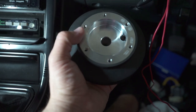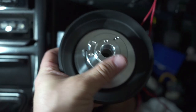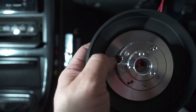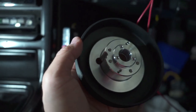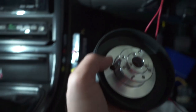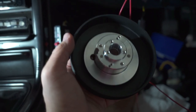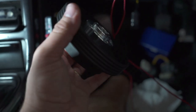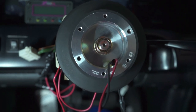There are two wires coming out of my quick release. I'm going to run these through the hub. Since I won't need the little copper backing plate, I removed it to have access to the hole where I'll run the wires. I need to build up enough excess so there's enough give for those wires to play, so the horn will work while I can still turn the steering wheel completely. If you have any other solutions, let me know.